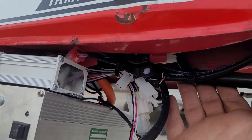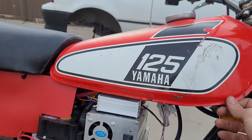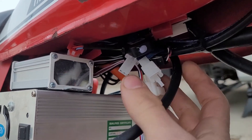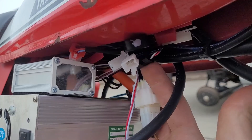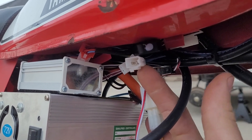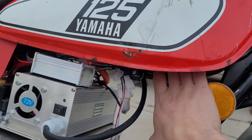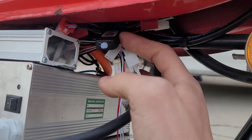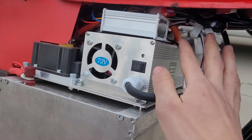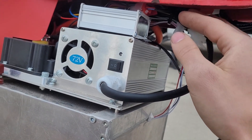Tucked up here near the frame tube recess for the gas tank — it's actually not that visible, that's why I tucked it all up there — is the main wiring harness. All this excess stuff is for the controller that I don't use. You can control brake lights and stuff like that off the controller, but I already had the original wiring harness. This is the Bluetooth module for the controller, so I can change parameters off an app on my phone — limit top speed, change the regen, anything like that. Super simple.